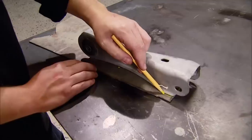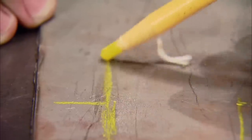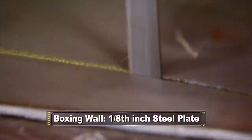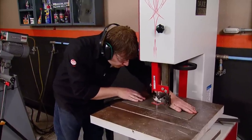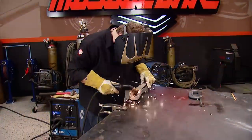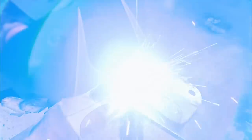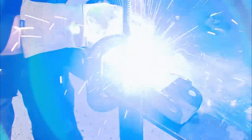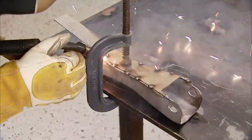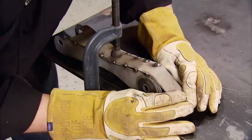With a nice clean slate, we can begin the process of boxing in the arm. I'm going to use a grease pencil to draw out an outline of the piece I'm boxing — you can do this with a marker too, or anything else that'll stick to the metal. I'm using a piece of eighth-inch steel, which is a little thicker than what the link is made out of, but there's no need to make this out of quarter-inch because the part's only as strong as its weakest point. When welding in a piece like this, I like to start at one end and work to the other — this allows you to bend and shape the boxing plate. Just tack, bend, tack until it's completely boxed, and a quick massage with a hammer takes care of the sharper bends.